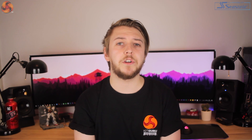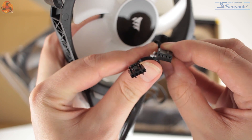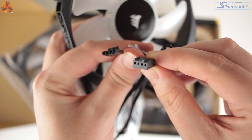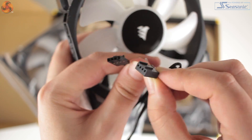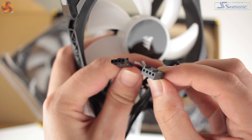Overall, looking at the H100i Platinum, it's a pretty comprehensive package. With a lot of RGB coolers I've tested recently, they came with a number of cables and controllers, so connecting everything up really required running through the instruction manual and could sometimes be a little bit excessive or overly complicated. However, the H100i Platinum is pretty self-contained. On each fan you have not only a 4-pin PWM connection cable, but also Corsair's proprietary RGB LED connection, and both of these cables run directly to the CPU cooler's pump.